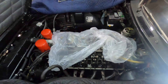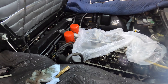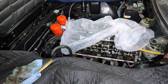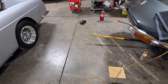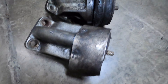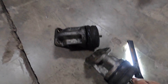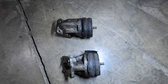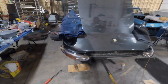The best way would have been to remove the exhaust completely, but the headers are weaved around the frame and it's not easy — disconnecting the seized pipes, sliding them forward, and so on. I just had to work around it, using all sorts of tools and tricks. I had to grind my tools down pretty thin — you can see I've ground this wrench so thin just to get it around the clearance for the nuts, with only a couple degrees of swing. It took about a whole day just to pull out those motor mounts. The parts are coming in the mail; one is also missing its heat shield, which I'll fabricate. The mounts were probably original to the engine and it was just time to replace them.